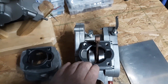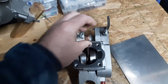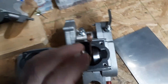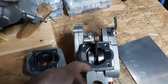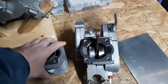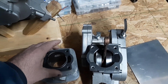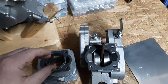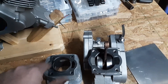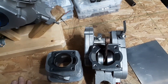We're going to correct the height. I've got a piece of aluminum right here and I've got a crank coming from a really good supply place down in Miami, Florida — he's got one sent out to me right away. It's guaranteed 40-41 millimeter stroke, which is going to put us exactly where we need to run this correctly. We're probably going to do a little bit of port work, but probably nothing crazy because 95% of those ports are going to be fully functional right out of the gate.